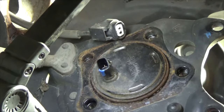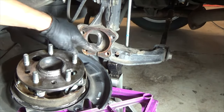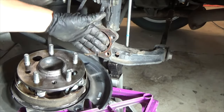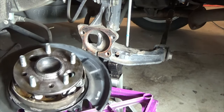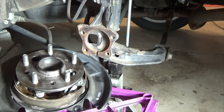The manual says to remove the wheel bearing, but what they don't tell you is the whole thing is going to come off because the wheel bearing is resting in the wheel carrier. The splash guard could be stuck to it with rust. You still have the parking brake cable, which is extremely difficult to remove when it's assembled. In my case, the whole assembly came off, so now I'm going to take it apart where it sits on the egg crate.